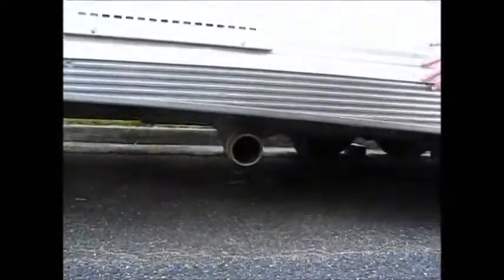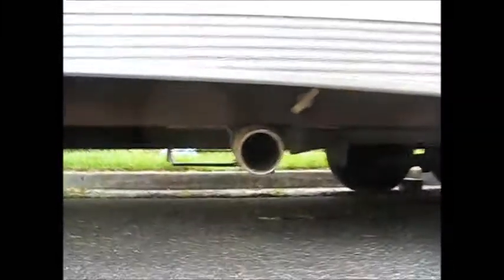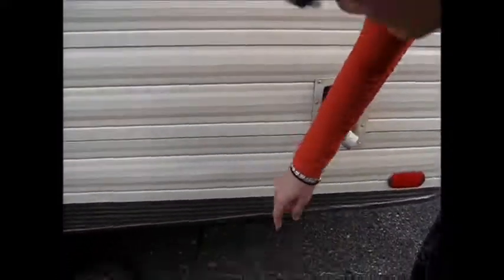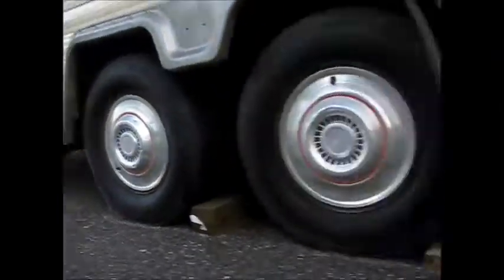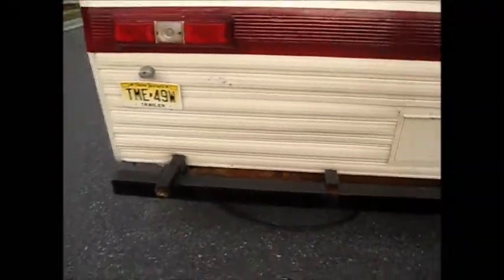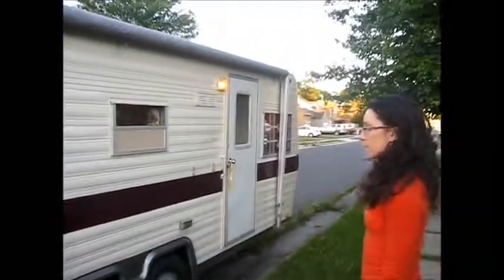At the bottom, this is your black water tank — that's how you hook up to empty out your black water. Looking at the tires, I'm not exactly sure how old they are but they look pretty good. Coming into the back, this is your electric hookup — I have that plugged in right now — and this is the access to that hundred-gallon tank; that's how you fill up your water reserve. Your gray water comes out the same way — you open up the other valve. Around the back you have a setup for a little bike rack, and this one back here is where you hook up your water — you open this up and get access to your water pump and plug into a hose.